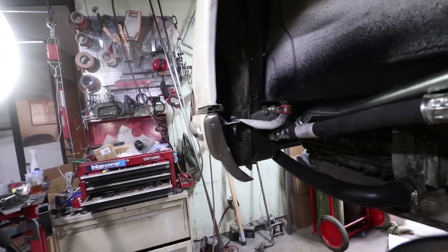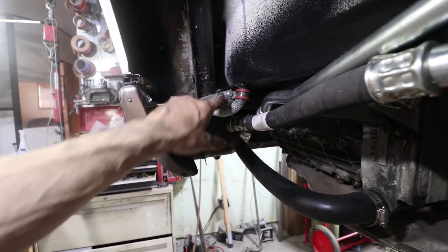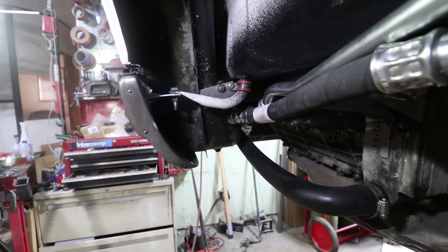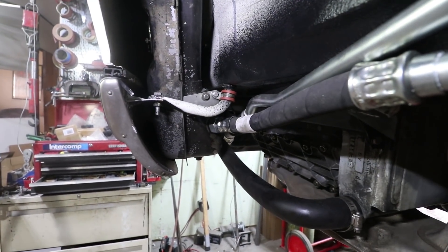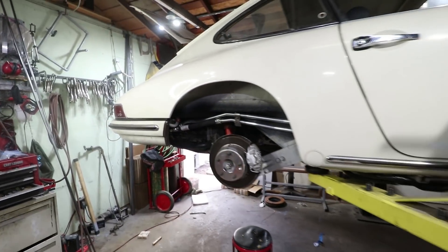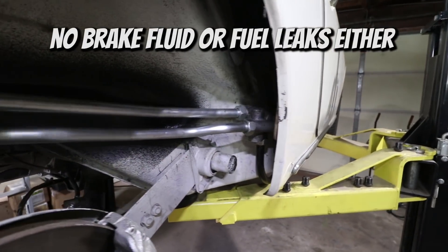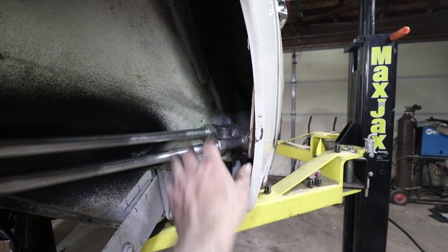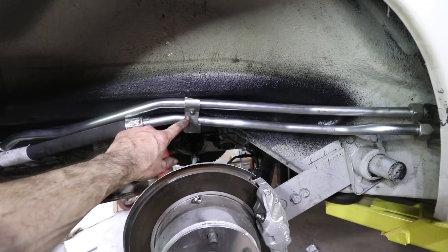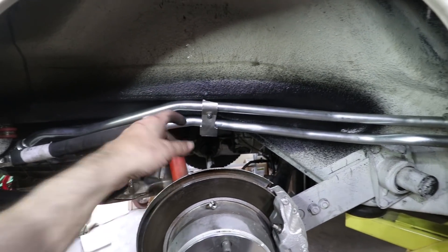The bumper's on. Before I put the tire back on I want to show you this bracket - and I'm going to apologize in advance to Benji for this. I made a little aluminum plate; there's some factory hardware that locks the oil tank to the chassis but I just used some generic stuff. We're getting down to the wire to take this thing for a ride. It's strong enough as is. All the leaks have been taken care of - no more leaks at these oil lines. You can take this wood out that was holding the thermostat in while I was tightening the nuts. This is a temporary clamp; I'm not sure the factory clamp is going to fit tight enough so I might leave this one in. Clean up the corners - this is also aluminum and the tire gets really close to this right here.